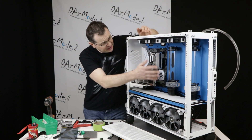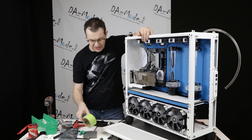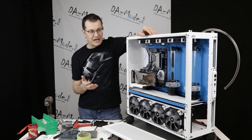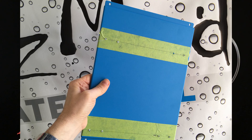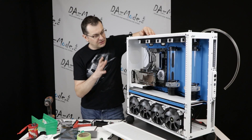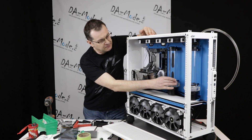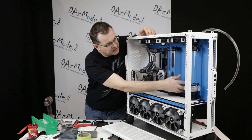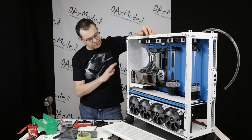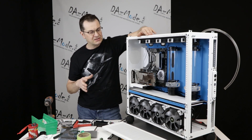So I have those two reservoirs spread out. I have to put some painter tape, mark it up, and drill the holes. As I mentioned last time, the requirement is basically no permanent holes in the case. For that reason we're going with soft tube mostly. The only place where I was allowed to make holes was for mounting the brackets, and those are removable panels. So the case remains mostly intact without any modifications — that's the target.